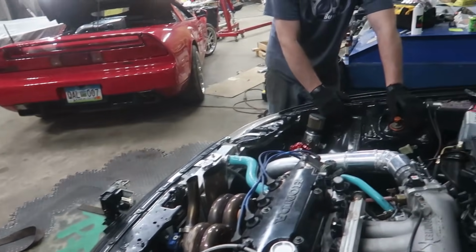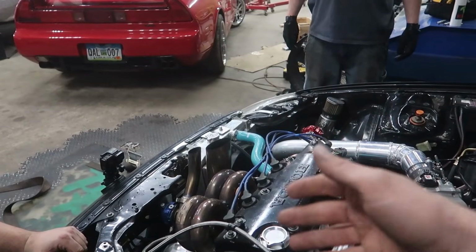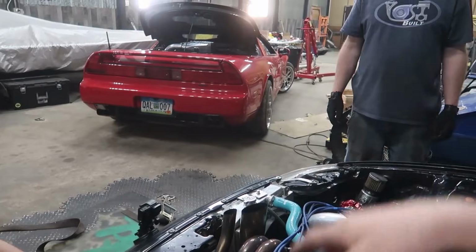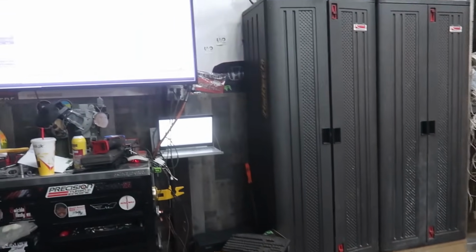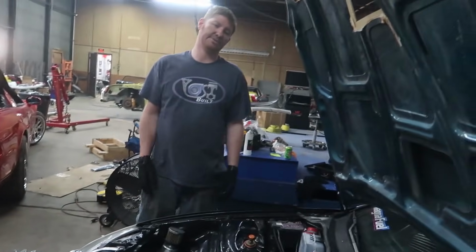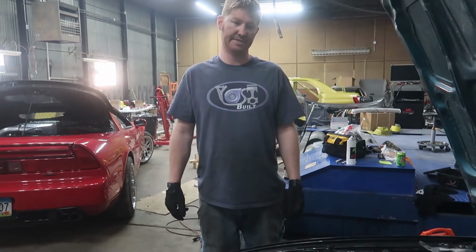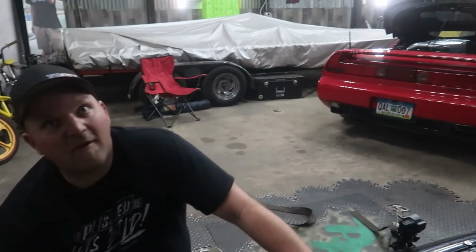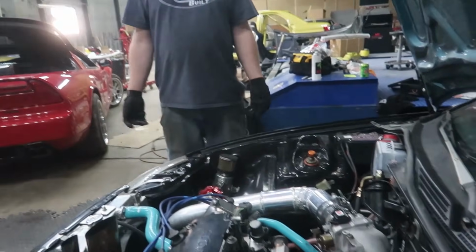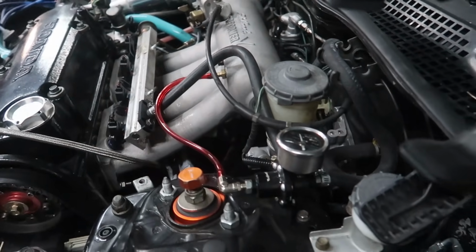Otherwise, it's just like all these deadhead systems where you're stuck at 58 PSI. All the Ks that are deadhead, even with thousands, you're stuck at 400 horse. The exact same thing's happening right now. That math is actually only giving a rising rate of about a half pound per pound of boost. This regulator could be a half pound regulator. I've never seen one. They're usually all one-to-one, unless you have an FMU, and a large ratio.